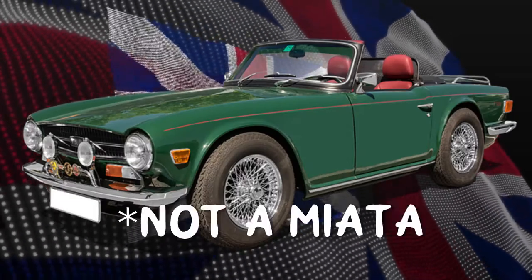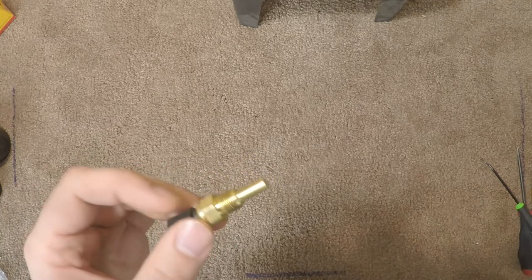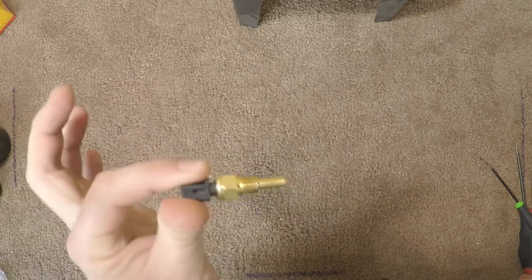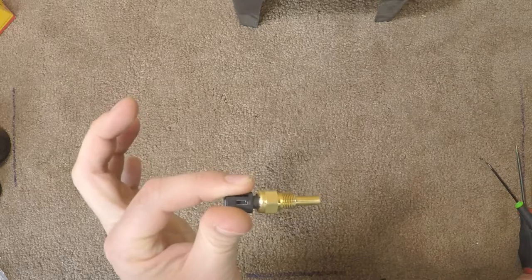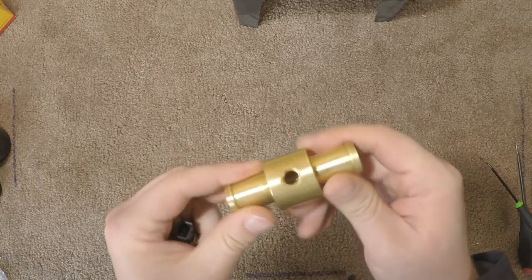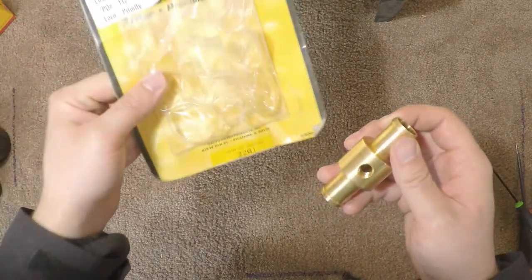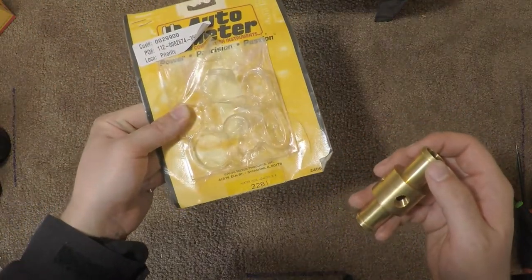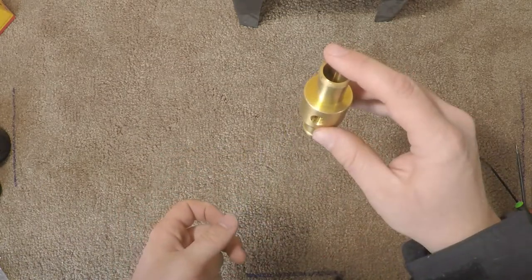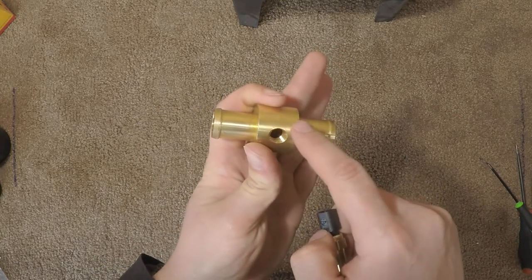Which is strange, to say the least. You could try to rig up an adapter, but from what I understand, it won't hold the sending unit into the coolant, and that causes a problem because you won't actually get an accurate reading. So what you can do is get one of these — it goes right in the heater hose line. This is Auto Meter part number 2281. I'll put a link in the description. You just put it in line with the heater hose, and that gives you a nice 1/8 inch NPT fitting.